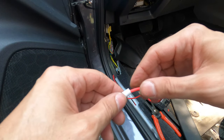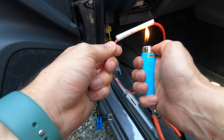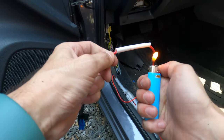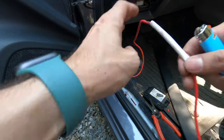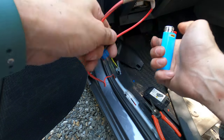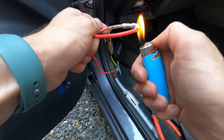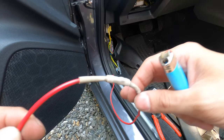When you grab your terminal connectors, just check the box and make sure it's the right size for the gauge wire you're using. Slip the heat shrink over the fuse tap and then stick in your freshly stripped wire. Grab your crimpers and give it a nice solid crimp for a good secure connection. Slide the heat shrink over the connection — if you have a heat gun it would be ideal. I didn't have a heat gun so I'm actually using a lighter, which worked out just fine. Make sure you don't hold the lighter in one place too long because you'll risk burning the heat shrink or the wire.